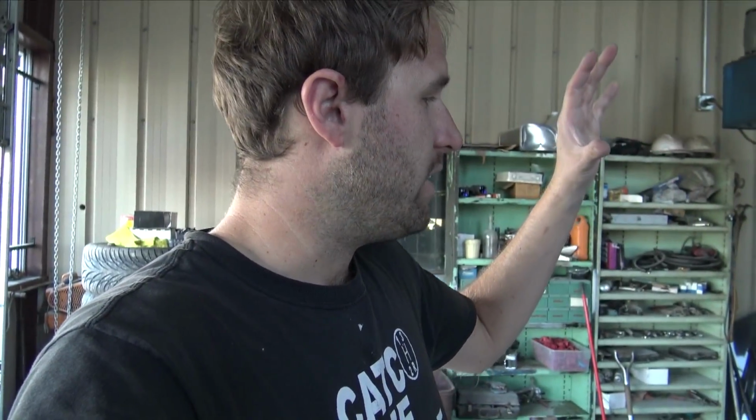I'm not exactly sure yet, but I may end up building it for boost, and they have drop-in pistons and rods. So I may order the pistons and rods, order a head gasket, and then just take the pistons, rods, and the block to the machine shop. I'm almost sure they'll say that I don't need to order bearings because the bearings look extremely good. They barely look even worn.